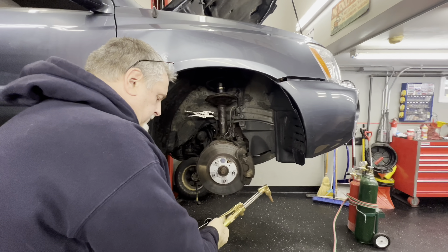I'm going to bring it right down to the end, then lift up on the strut from the inside, hold it up when I take this off, and feed the strut out. This thing is out. We're going to match it up — there's a left and a right for this thing. If we lay it on the ground, the sides are lined up with the brackets and the hole, so we're good. These are the new nuts. This sticker tells you not to take this nut off. These new ones are all 15s. We're going to feed this thing up into the hole, catch a couple of them, and change my socket over to the 15 so I can zip them all down evenly.